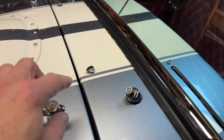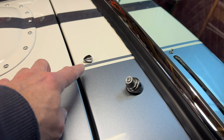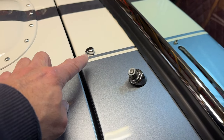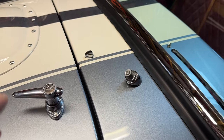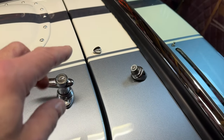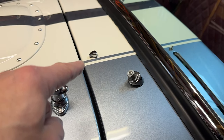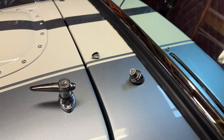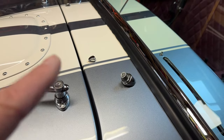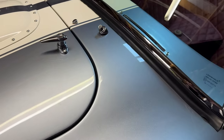Just make sure when inserting anything - if you have trouble inserting it, don't force it. You'll probably come to realize you can't get it all the way in, and when you pull it out you'll pull a load of paint out or chip it. Make sure things go into the holes nice and smoothly. I just had to open up one washer jet hole very slightly where a little bit of paint was on the inside. I've got the windscreen wipers in but haven't put the motor in yet - not doing that until the windscreen is finally bolted in.